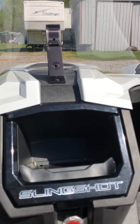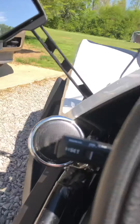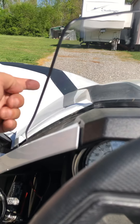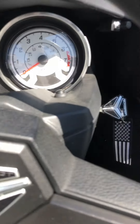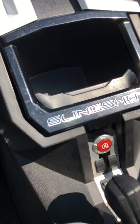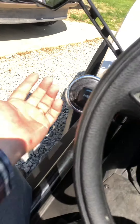I found a tester, found the hot wire, and spliced into it. With the pocket panel out, you can route the speaker wires out underneath the hood. Lift the hood, come out on the firewall, lay the wire right in behind the firewall — it's virtually invisible. Bring it right through here, tie into the hot wire, find a ground, hook up to your switch, mount those speakers, and that's it.